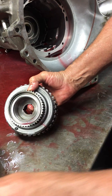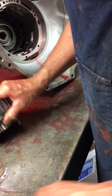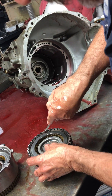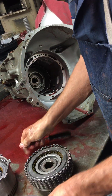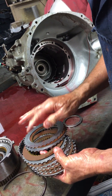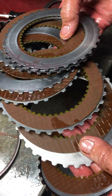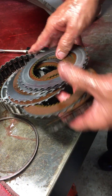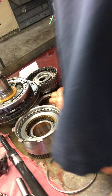This is your forward clutch — the shaft comes in here and splines into it, and when this clutch engages that's what physically moves the vehicle forward. Let's look and see what's going on — check if the clutches are burned. When he dumped the fluid that fast, you can see how dry the clutches are. There was no fluid in this transmission; he slung it all off. They're completely dry — the friction plates will definitely have to be replaced.